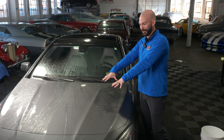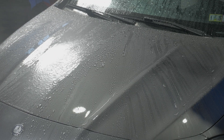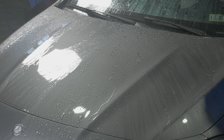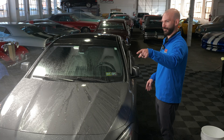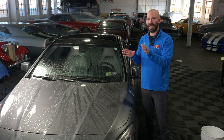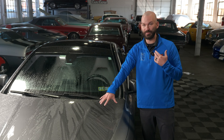Right now you can see very clear, good beads on this side, not so much on that side. The problem there when you drive — water is going to stick to the far side surface a lot longer, and things like dirt, pollen, and debris are going to stick and dry on your car. Beading — the hydrophobic component — is good; you can see that water is quickly running off. What's confusing here is that changing nothing about the coatings, just changing the way the water interacts with the surface, completely changes how we describe what's happening.